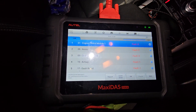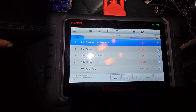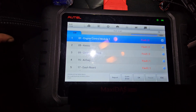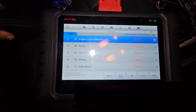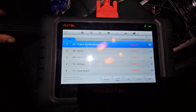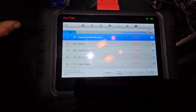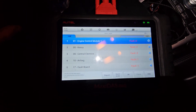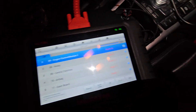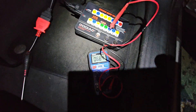Just to do a quick summary on CAN network fault finding and communication faults: the first point of call is to disconnect each module one by one. Obviously some vehicles have up to 50 modules, so it can get a bit tedious and time consuming. There was no clear sign of water damage on the module, but the customer told me it had been driven into water and quickly driven out. Using the breakout box or a multimeter, you can go across pins 6 and 14 on the OBD socket itself and get the same reading, just to make sure your network is intact.